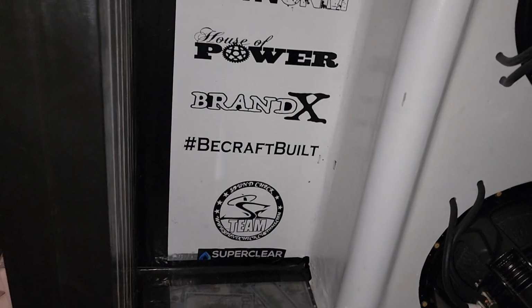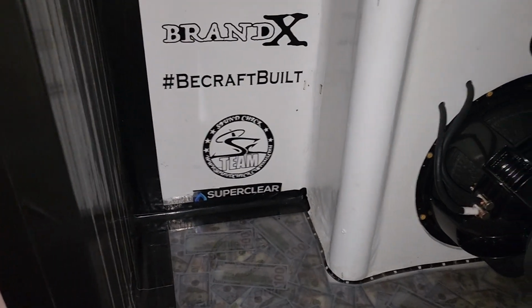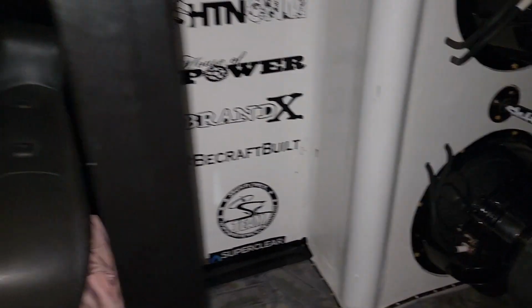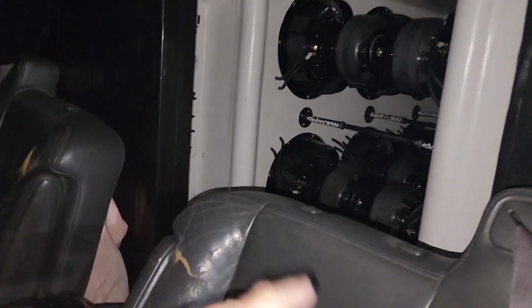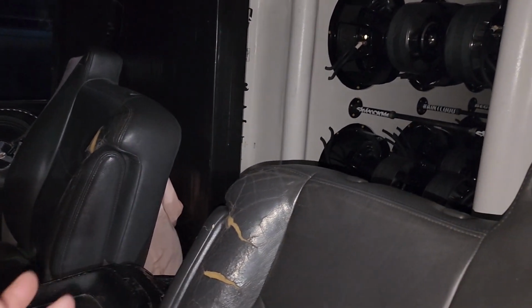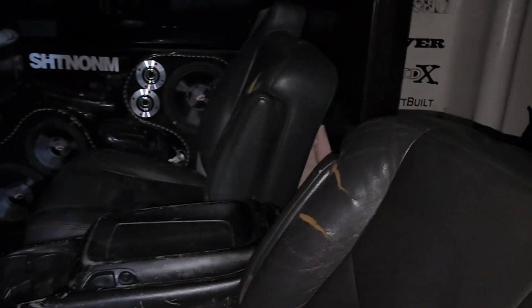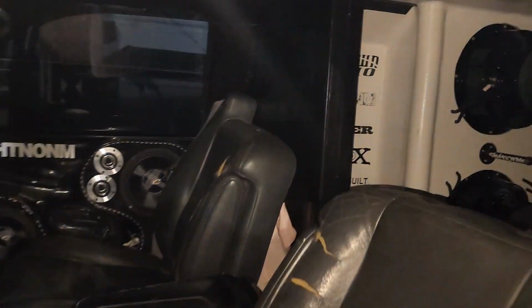So this part of the loading wall is almost like in compared to the back corner. So sorry about the camera there, but I've been wondering why I've got a bunch of dead spots back there in that corner. And I'm sure it's going to have dead spots anyway, with it being driver's side port like it is. It's going to kind of pocket some stuff back there, but it's way worse than it used to be. So I think this loading wall needs to be brought out a little bit just so it's straight. That should gain just a tiny bit of ported area.